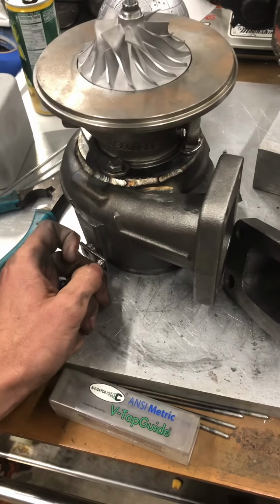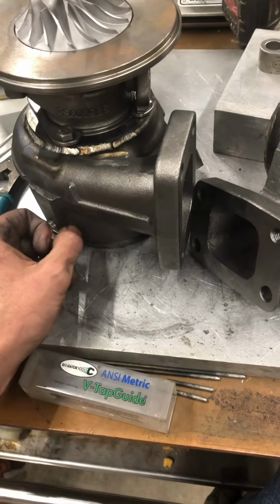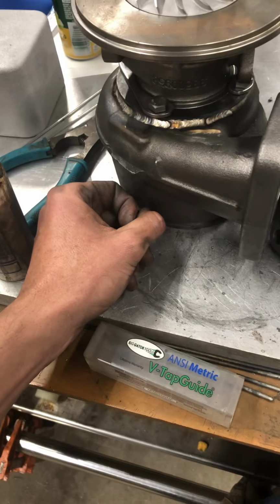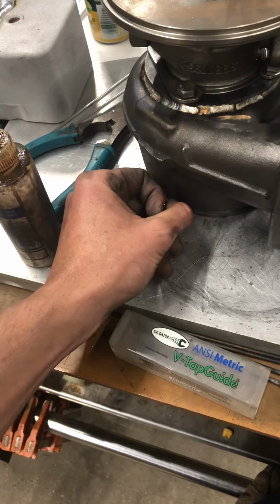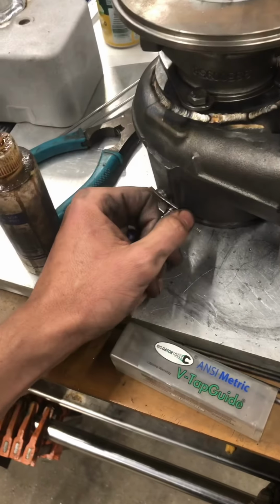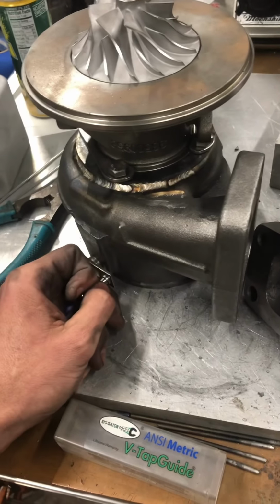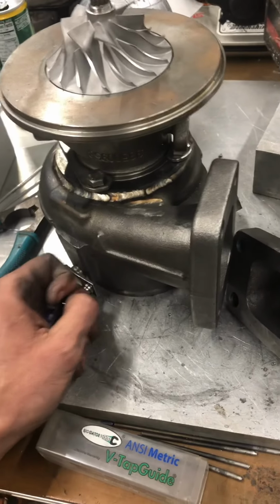Turbochargers I'd like to look into are the EFRs from Borg Warner. They look like a really good charger. I just don't know anybody locally with one on a diesel. Power Driven played with them. They actually did 500 horsepower and 1,500 foot-pounds of torque at, I want to say, 1,500, 1,600 RPM in a compound setup with one of those on the manifold, which is pretty nuts. So obviously the responsiveness as well as the high flow efficiency is there in the Borg Warner EFR stuff. They're just kind of pricey to try. One blows up, or it doesn't work, it gets real annoying really fast.